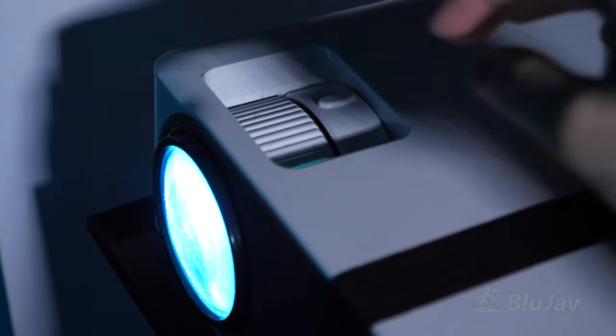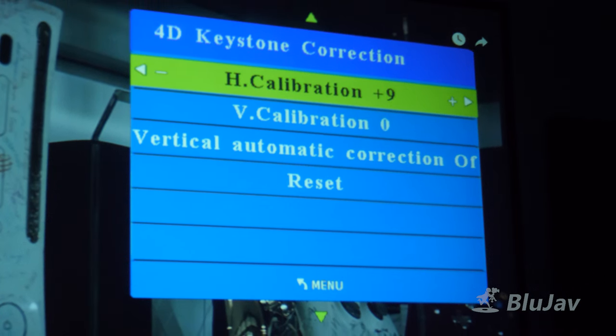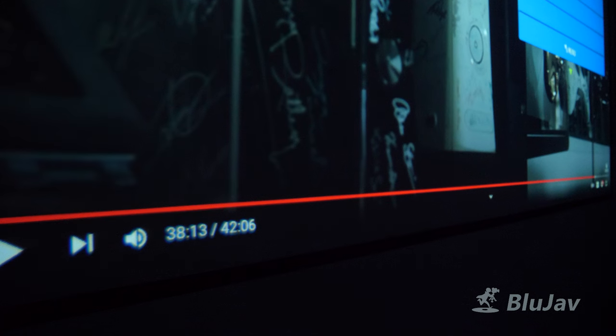Let's look at some of the features you can use on this projector if you are unable to project the image straight on. One is using the lens shift, and the other is to use digital keystone correction. But there's one very important difference between the two: if you use keystone correction, your display resolution will be compromised. You can see this effect when you have straight horizontal or vertical lines in the image — you will notice aliasing or jagged edges on those lines. So ideally you would want to use the lens shift to adjust the image as much as possible and keep keystone correction to the minimum.